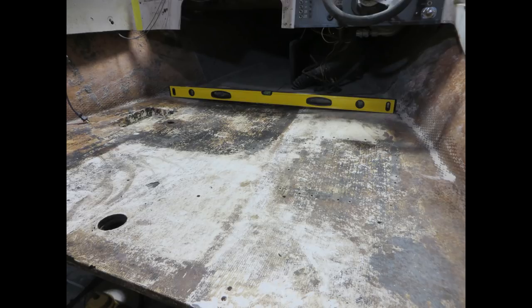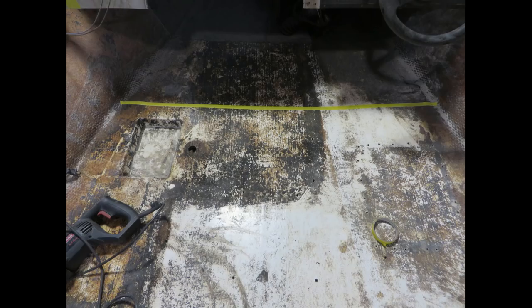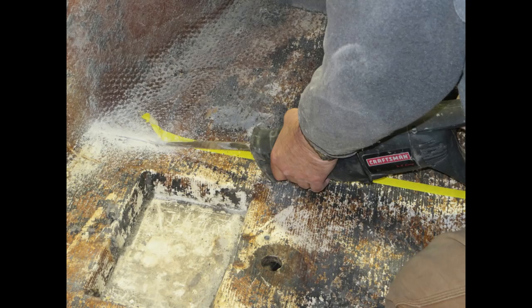The early advanced models with composite floors are notorious for sagging in the forward center section. The 26-inch span between the main stringers is a little too much for this floor thickness — you can see about an inch gap right there, so this needs to be addressed. Normally I would section out the center section only, but because we've got such wet foam on both sides, I decided to go ahead and cut the entire floor out from about the dash aft.